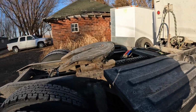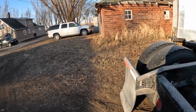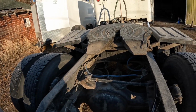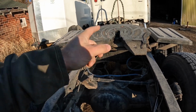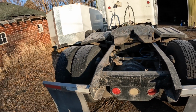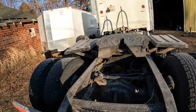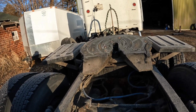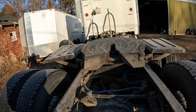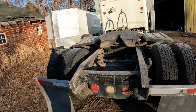The smart man that I talked to suggested that I could possibly have a differential problem. One of them's going out and they're fighting each other, causing my vibration. So the suggestion was to take out the intermediate shaft and put in the power divider so that they're not fighting, and find out if we have a problem.